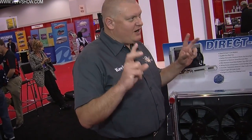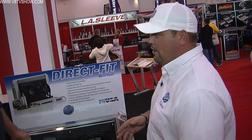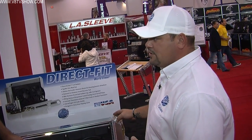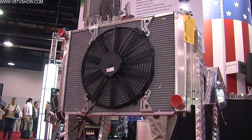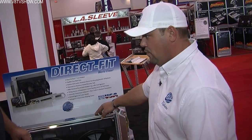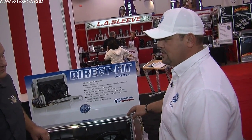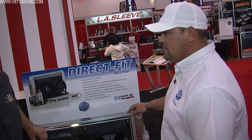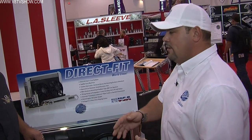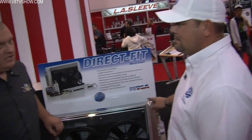More core surface area means more airflow and more cooling capability. How did you come up with your horsepower ratings? It's very simple — we took a 22-inch, 24-inch, and 27-inch core design. Our 400-horsepower applications have a single fan with a 22-inch core. The 700 as you see here is a larger 24-inch core with dual fans. Our 1,000-horsepower is a 27.5-inch core with twin 13-inch fans. We've made it painless for the end user to just say 400, 700, or 1,000 without getting into all the mathematical and scientific equations.